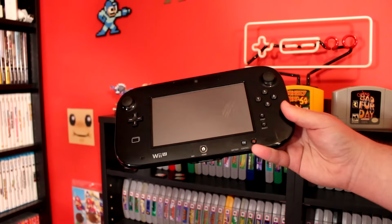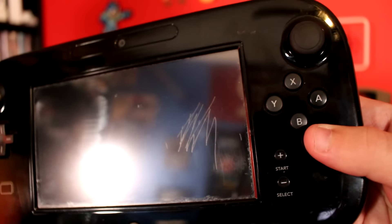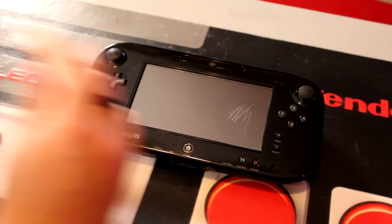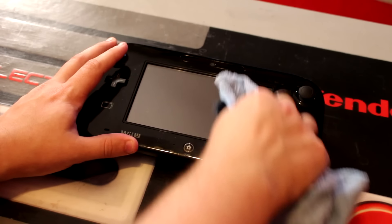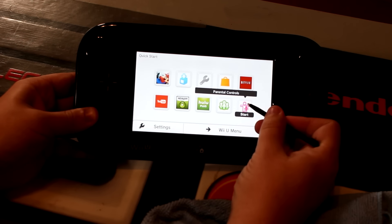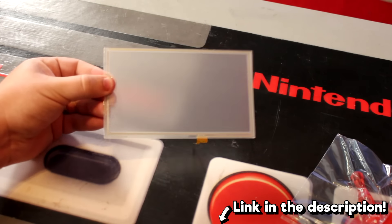But what about the gamepad? Those scratches are particularly deep. I considered trying to fill the scratches with some sort of acrylic resin, but upon closer inspection they looked pretty rough, and I was worried it would make them permanently visible underneath a new layer of plastic. I also considered using the same plastic polish to eat away at the highest layers of the touch screen — though I do not recommend doing this at home, as you're much more likely to damage your system using an abrasive on a surface that isn't purely cosmetic. Luckily, the Wii U's touch screen is manufactured in two separate parts: the LCD panel itself, and the touch screen digitizer — a thin layer of plastic which detects input from the gamepad's stylus. The digitizer is what is actually scratched, not the display itself. And a replacement touch digitizer is only about $10, so why not do it the right way?